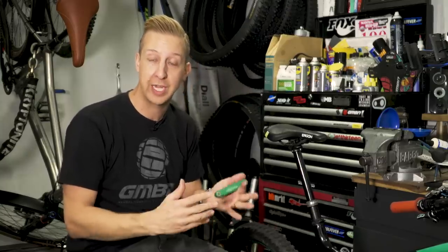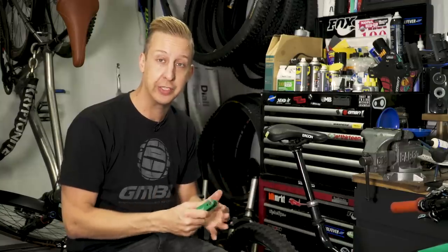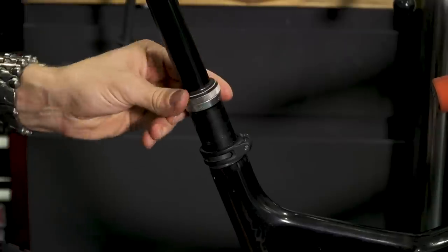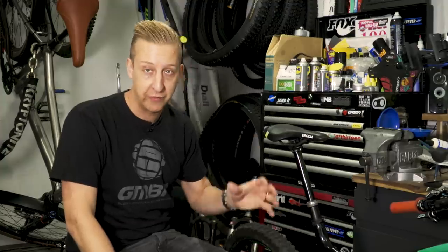It's not for the purpose of lubrication on the actual bearings — it's more to act as a barrier. With heavy duty grease, it's a water repellent, ideal for keeping moisture away from delicate moving parts. I'm going to start here with the seat post because this is one of the first entries to the frame. It can damage other things like bearings when water finds its way in.